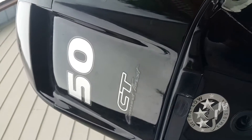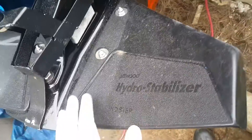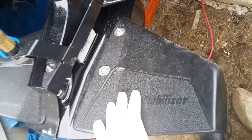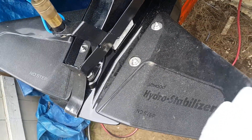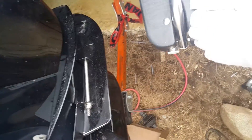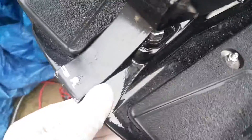This is the engine — it's a 50 Command Thrust. These things are your zinc anodes. I've got hydro stabilizers on mine. These aren't bad — I would not have installed them, but I was suffering from issues with this motor going up on plane. They have some bad points and some good points, but overall they seem okay for this application. The reason I don't recommend them is you have to drill bolts through your anti-ventilation plate.